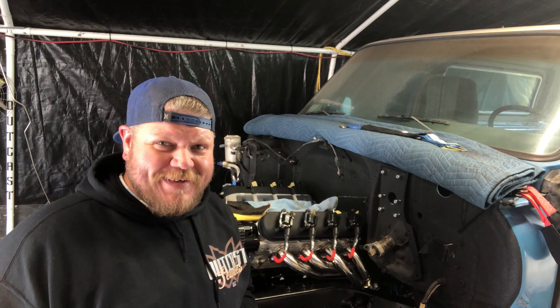There you go guys — there's the plugs and wires on the driver's side. The passenger side should be pretty much exactly the same. We can come over and take a look — it's not much more difficult, though we do have the AC here so we might have to go with the shorter extension back there. Once we get the spark plugs and wires in on this side, we'll go ahead and torque down the header bolts, just in case we'd have to pull them off like we almost did on the other side with the swivel.